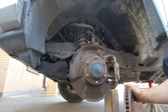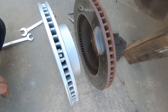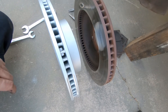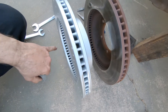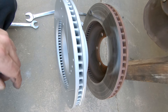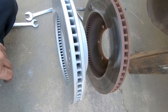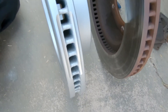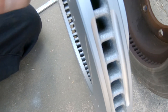I'm pretty sure these are the factory rotors since the previous owner did all dealership maintenance. Here are the replacement ECCPP rotors — you can see they're about the same thickness with the same venting gaps in between, which is really good. Cheaper rotors will have less venting — the ribs will be spread farther apart and usually thinner metal. So these ECCPP rotors are made really, really well. And the cross drilling — the holes actually match in between the ribs.